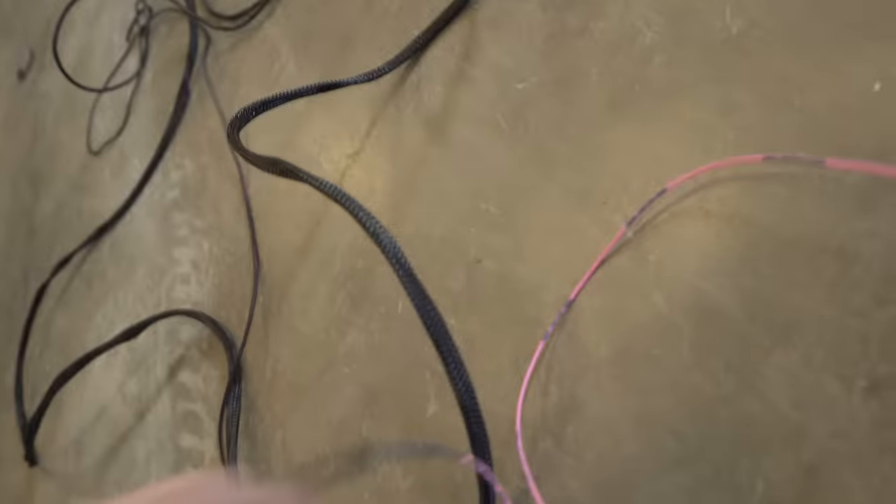Red to red, black to black — the two butt connectors are connected and good to go. Don't forget to put the air filter on the end of the compressor. Now connecting the remote turn-on: I'm adding an inline fuse to this wire — always have a fuse on any power line. The fuse I'm tapping into is the 7.5A Ignition 2 fuse — that's what's labeled on this fuse box. I had to pull off one of the tabs in the fuse box to fit it. That's the only fuse that actually turns off when you turn off the car.